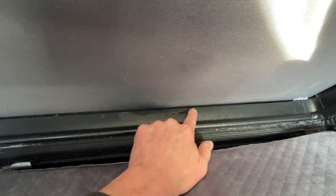It's just damp all along here. When this thing is closed in the winter time and you get those extreme temperature changes in a closed, almost airtight space, you create massive amounts of condensation because the temperature just swings so wildly day in and day out. So the only solution to this is on days like today, when it's sunny out, you need to open up your tent. If you leave your tent closed for months over the winter time while it's on your vehicle and you're experiencing those temperature fluctuations, it's just going to keep collecting and collecting.